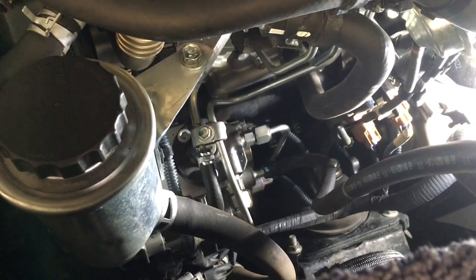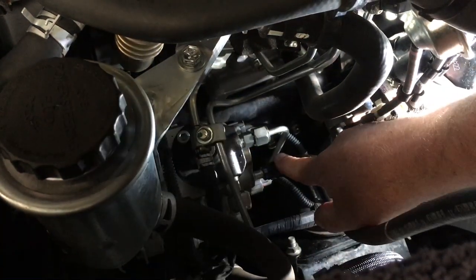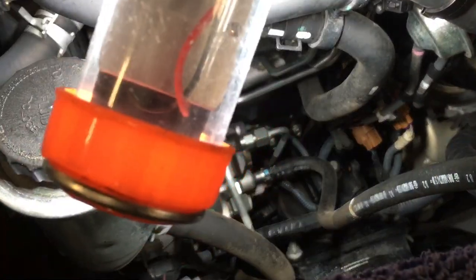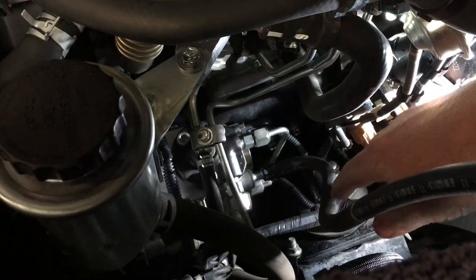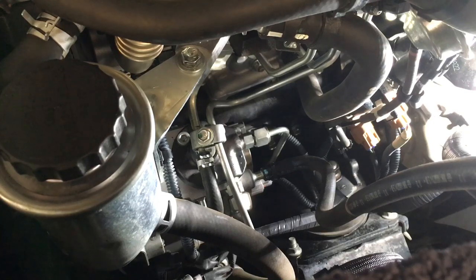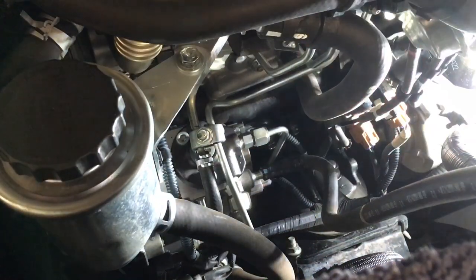It's very awkward place to have a camera. Suction control valve is down there, so the first thing we need to do — we've got the cover off the intercooler because that curves around the side here and gets in the way a little bit. That would be the first thing you need to do. The second thing is to take the clamp off that fuel line and remove the fuel line out of the way. Make sure everything's nice and clean — there's no filtration on your engine after this point.